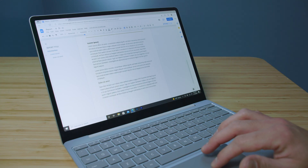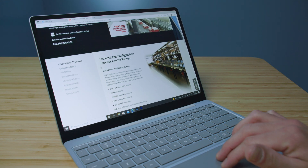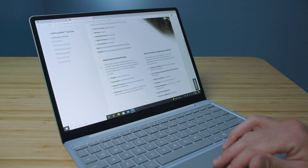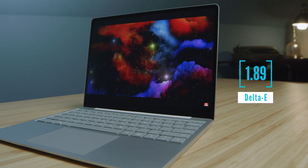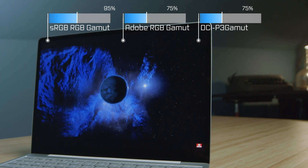The next thing I want to talk about is the screen. This 3 by 2 aspect ratio is really, really good — it allows a smaller screen to feel bigger. When you have a taller screen, you don't feel so scrunched down into what you're working on, whether you're writing a doc or reviewing a website in pre-production. With this screen, because it's so tall, it feels like there's a lot of breathing room — it feels very open. It's really deceiving how big the screen feels for the size it actually is. Regarding screen brightness, color gamut range, and color accuracy: the sRGB is solid. We have a little bit lower on the Adobe RGB and DCI-P3, but with the sRGB you'll still have pretty solid color accuracy. I was impressed to see this laptop have a screen brightness of over 300 nits.